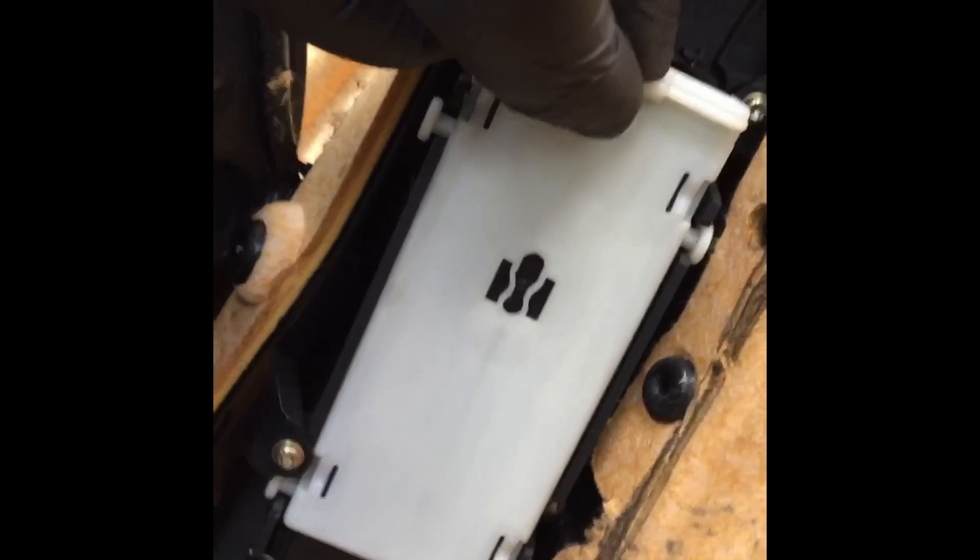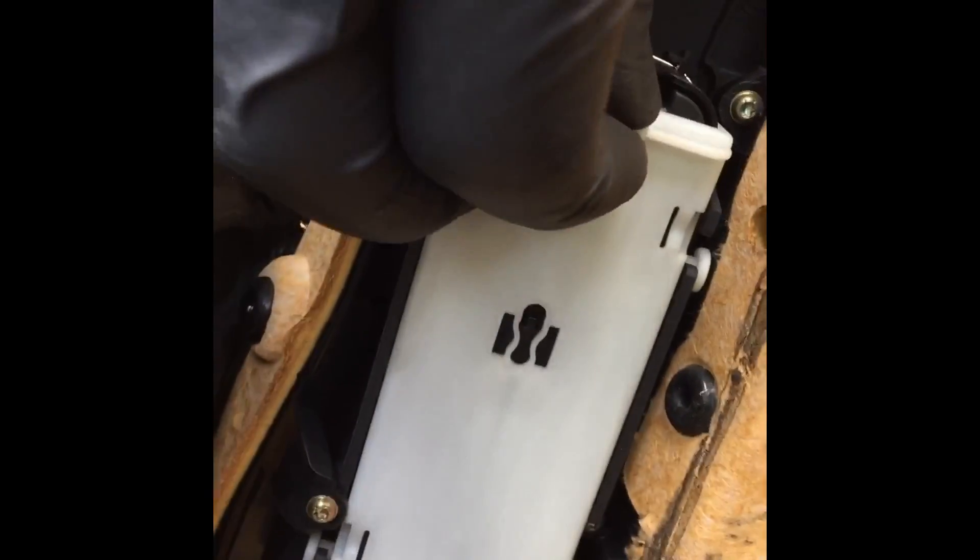When the switch is in the back of the door, there's a slider thing — you just pull it up and then the whole switch assembly comes out the back of the door panel.